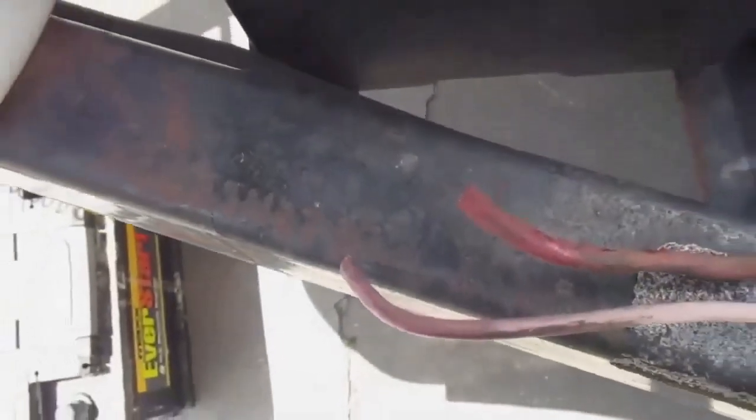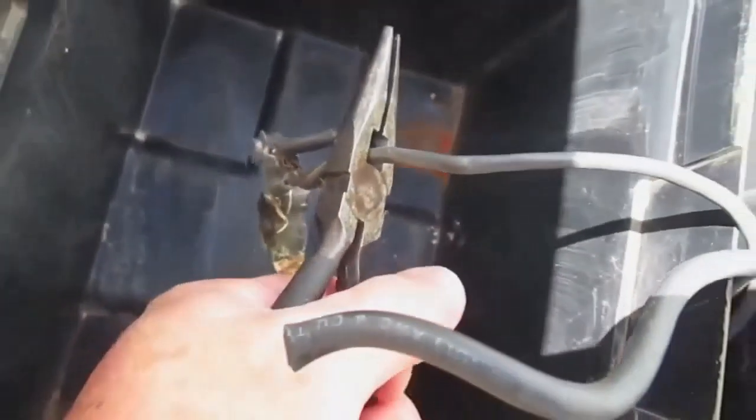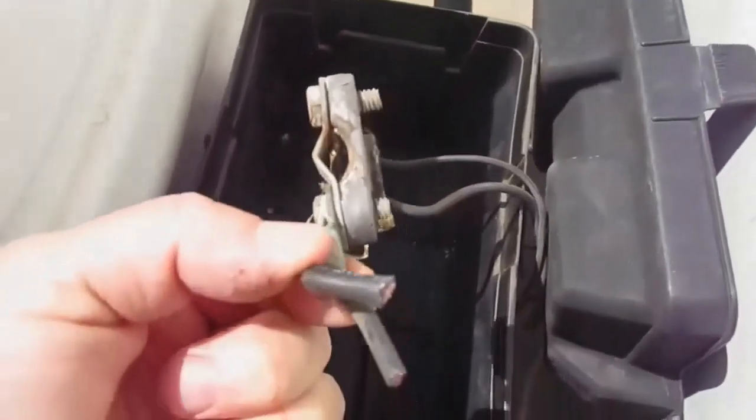So I removed the battery. I also snipped the connectors to the battery — they were pretty corroded as well. I'm trying to show you how I was able to snip it while holding the camera at the same time, which wasn't easy, but I got rid of those connections and tossed them. I cleaned out the battery box that the battery was in, removed insulation from the ends of the cables, and installed new connectors. That corroded ugly thing goes straight into the trash.